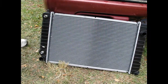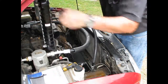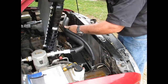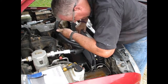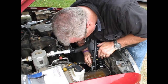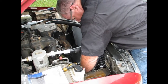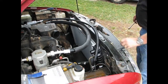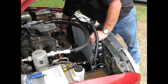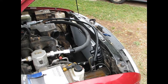Now the radiator is ready to go in the truck. Make sure you've got the little cushion mounts that go down on the frame in place — I noticed this one had pulled off with the old radiator and I missed it. Just push them in and wiggle them until they snap. We've also got to put this little radiator hose on the other side. Now for the top part of the fan shroud.